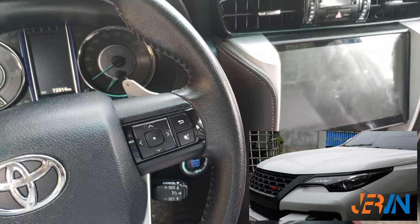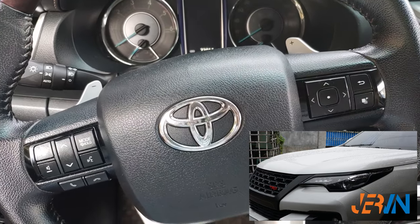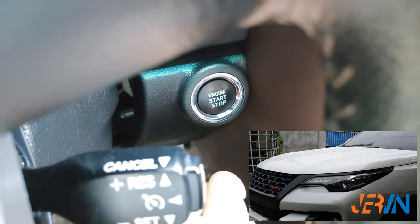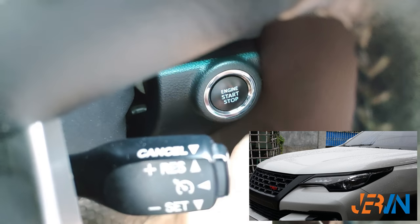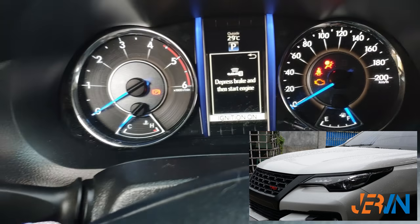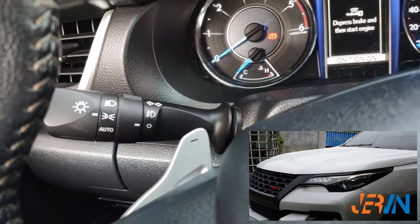Welcome to my channel. Today I will show you how to adjust the sensitivity of the sensors of our auto headlight. Let's start: switch to ignition on, make sure the dimmer switch is in low beam and not pushed forward into constant high beam, then turn the light switch onto park light setting.